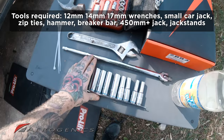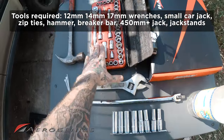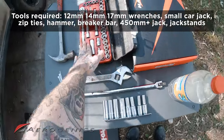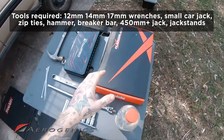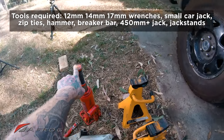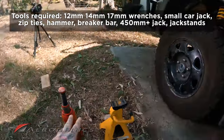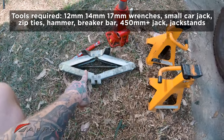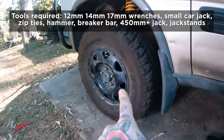There's a bolt at the bottom of the strut assembly that requires two wrenches — either a breaker bar and your socket kit, or an adjustable wrench and your socket kit. I believe it's a 17mm. You'll also need a good high jack to get the front up high enough. If you're running 235s or lift springs, you'll want a bigger jack or a wood chock, plus jack stands, and likely a low-profile jack for reassembly.